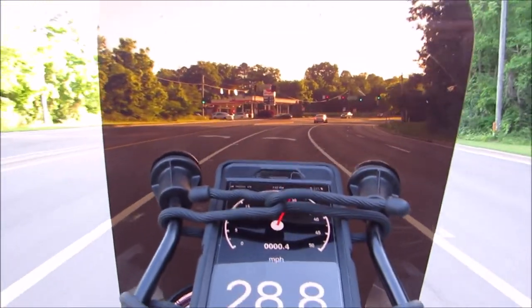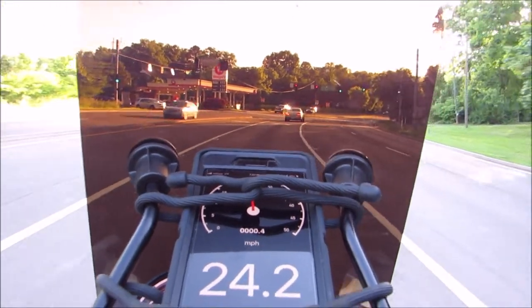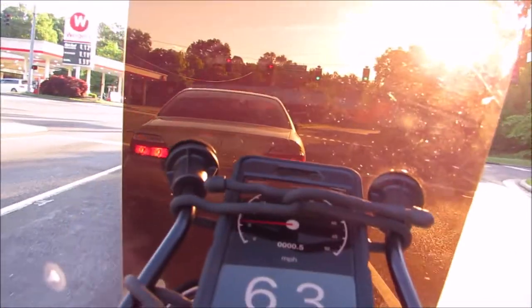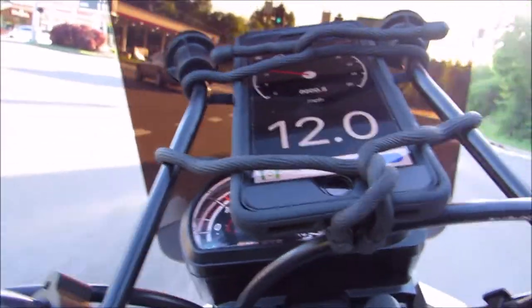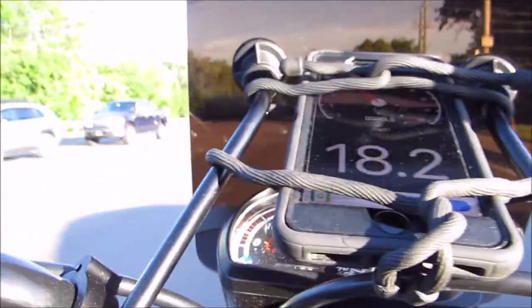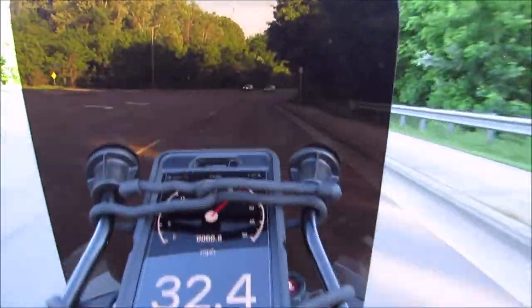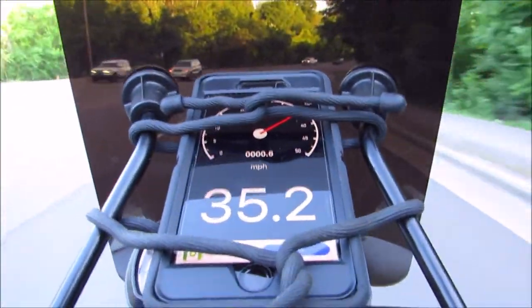Now, like I say, the only real thing about the 4 grams is that they were so jumpy at the beginning that if you were trying to get through a doorway, it almost gets kind of loose. That's where the 4.5 is a little smoother, but they're both really, really close. The 4s just have a little more vibration, I believe, with the higher RPM, so you feel like you're going faster even though you may not be.